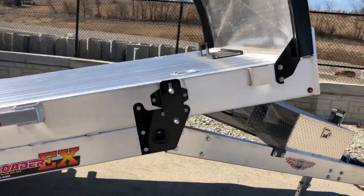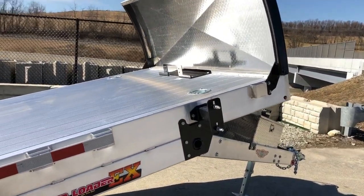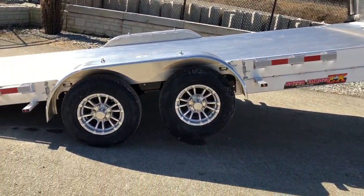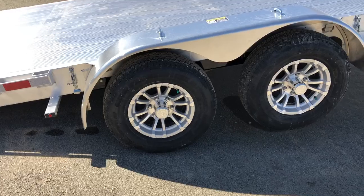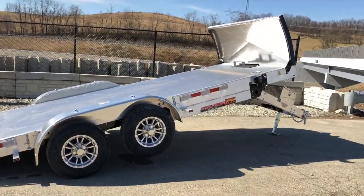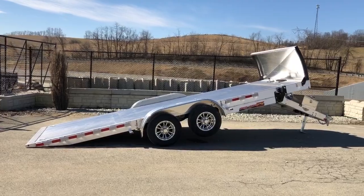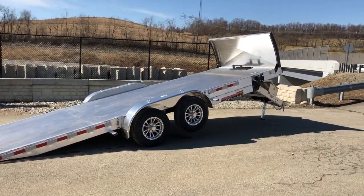Spare tires on these we generally keep in stock. Most folks would do a matching aluminum, but we also keep steel in stock. Winches — we keep 8,000 and 12,000-pound in stock and can certainly put a winch package on any of our in-stock trailers. This one with the plate would certainly make it easy to do so. It's a 225/75 R15 8-ply radial tire — standard equipment. As equipped here in a 20-foot length, this unit's going to weigh a hair over 2,000 pounds — ballpark around 2,200. Take that off the 10,000 GVW and you're going to get about 7,800 pounds of legal payload, not counting your tongue weight, which is carried on the ball and transferred to the tow vehicle.